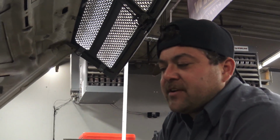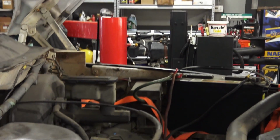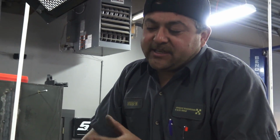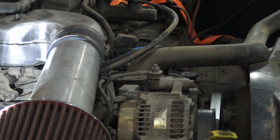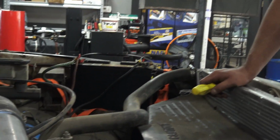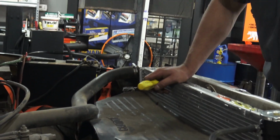Yes. When you get to a certain extreme, say you do an engine build that has high horsepower at a higher RPM, then you want to go with a higher stall. So it depends on how built your engine is, but typically on something stock or mildly built, I go anywhere from 2,000 to 2,500 RPM on the stall. Yeah, I've heard of the 2000 converter, that's what they call it. It basically gets you out of the hole quicker. It feels like you gain another 50 horsepower or so. I'm all for getting out of the hole quicker. Oh yeah, definitely. That's what she said.